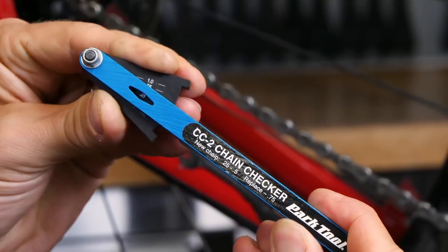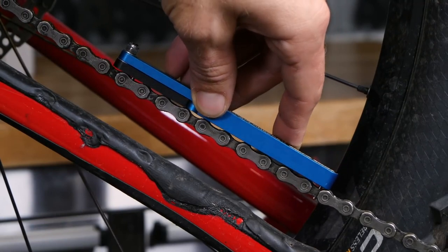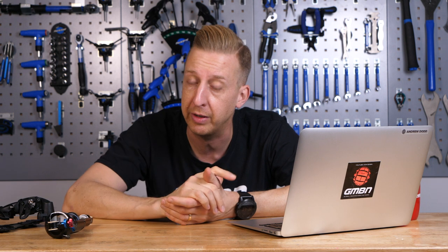Ride it until it's worn out. Get yourself a chain checker so you can monitor wear, and then when it's finally worn out, hopefully you'll have saved up enough money for a 1x transmission. I don't think you need to go as hard as 1x12 — that will cost more. I reckon 1x11 or 1x10 would be fine. Since you've got a 3x9 you could go 1x10 on your current setup, no problem. You might need a different rear hub for anything bigger since the freehub body is slightly wider — that's when it starts costing money. Get really fit, destroy the climbs, wear out your transmission, then at that point get a new chain, cassette, and rear derailleur, and go 1x on your existing cranks. Nice and simple.